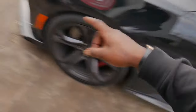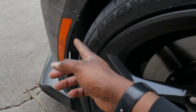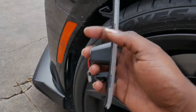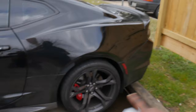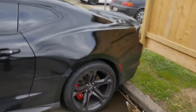I'm going to be installing those today. I'll start off by turning the wheel to the passenger side — I believe it's just a couple torx screws you have to undo to get the fender liner to peel back. Then you just push up against the tab on the stock side marker and push outwards, and they should just pop out. Then it's literally plug and play, super simple. For the rear, I'm probably going to take the rear wheels off just to get to it because, as you guys know, we do have the ZL1 style rock guards on that joint now, so there's not going to be enough space trying to get those off while the wheel is on.